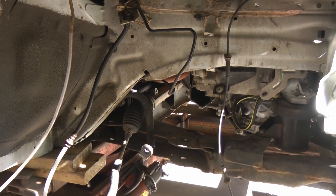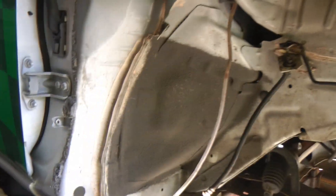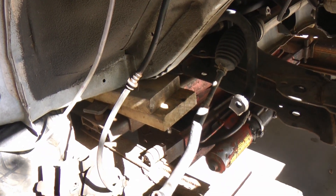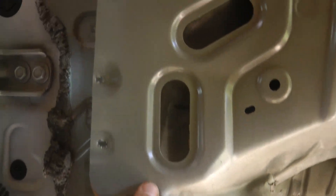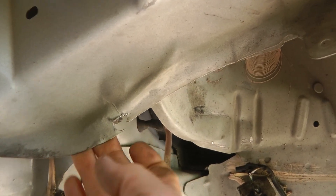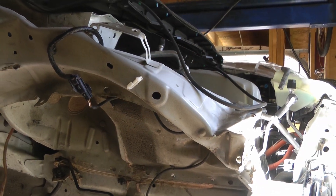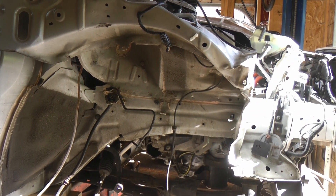Well, change of plans here. I got in here, and I really do think that this is not bent, and I think the strut mount is not bent. So if I were to just replace this lower control arm plate thing here and the sway bar link that was here, I would have a car that would drive straight. The thing is I was hoping I could remove just this inner fender skin and get a new one of those. It's just spot welded, and I started drilling out the spot welds, and I just can't get it apart. If I can't get it apart, there's no place to mount the headlight, no place to mount the hood, no place for a fender. So technically while it would drive, it would technically probably be illegal too.